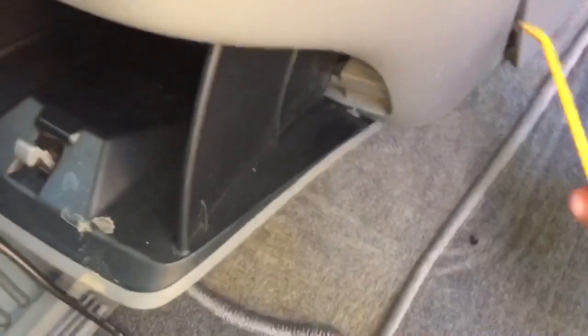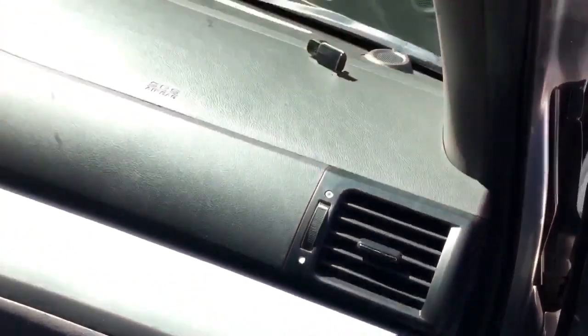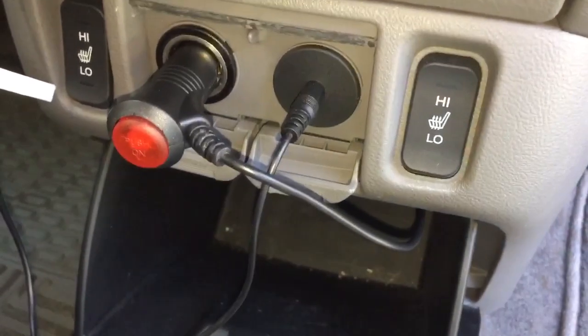On the inside of the vehicle I've installed the camera charger where the charging port is. I'm going to open this up — it pops open. I can take the wire, run it up here, and take it all the way into the side liner. The nice thing is you can pull the liner out and the wire can run in the little groove we have here. I can use that to run the wire all the way up, and then when it gets to the headliner I can push it under and install the camera almost right behind the rearview mirror. That's the master plan.